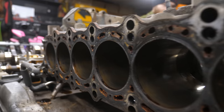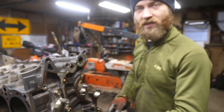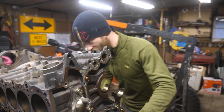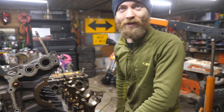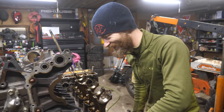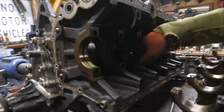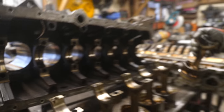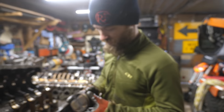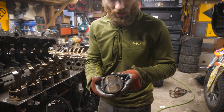The block looks great. The cylinders are a tiny bit worn, as you'd expect for an engine that's run for an indeterminate number of hundreds of thousands of miles. A couple of them have a few little spots of pitting inside on the edge, but really minor. And honestly, the pistons and rings are probably pretty good too — a little dirty, but not even that bad.